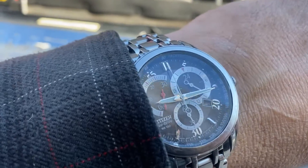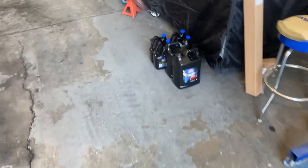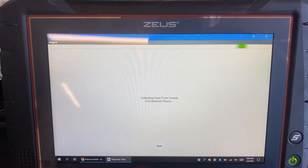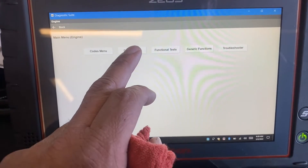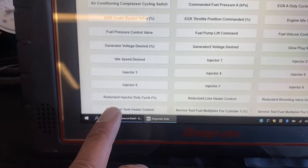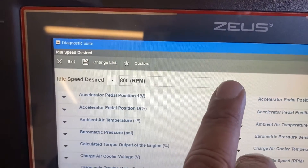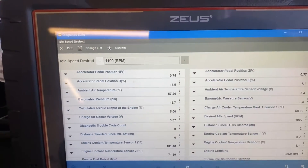We're going to run it for about 35 minutes and elevate the RPM. Using the scan tool, we're going to go to output controls and elevate the RPM. The truck is already warmed up and I already ran a partial regeneration. We'll go to functional, then output, and elevate the RPM to about 1100. If I didn't have a scan tool, I'd use a throttle stick to hold the accelerator pedal around 1100 RPM. We're at 800 RPM now — raising it up and holding it there.